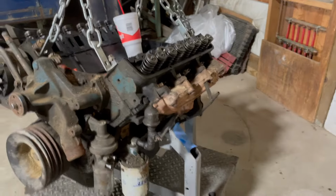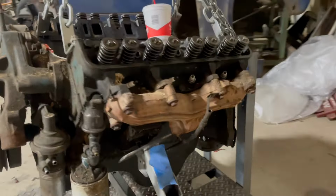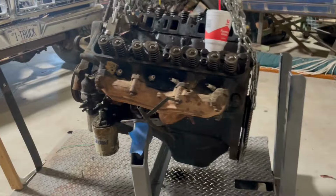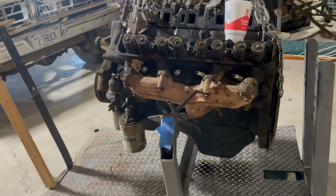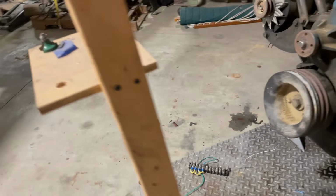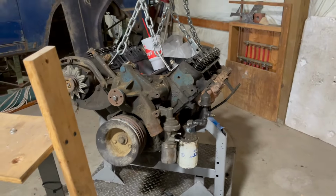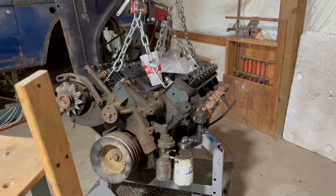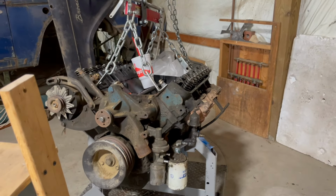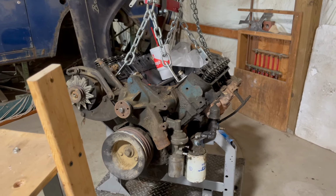sitting here. Obviously the truck motor mounts don't line up with the car holes we made in the past, so we're gonna have to slightly modify the run stand probably for that to work, but it's good enough for now. I ordered a gasket set for it and a timing chain, so I'm gonna take it all apart, knock the heads off, and just make sure I don't have any burned valves or anything like that. Relap the valves in, ignore the entire rotating assembly probably, and put it back together with new gaskets, fresh paint